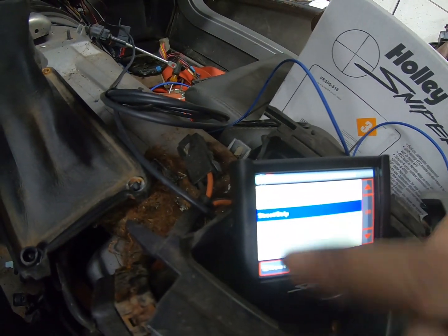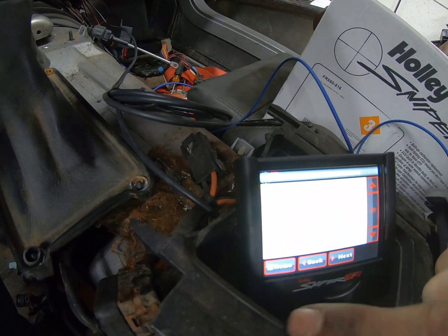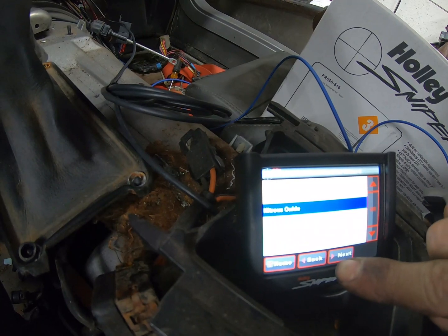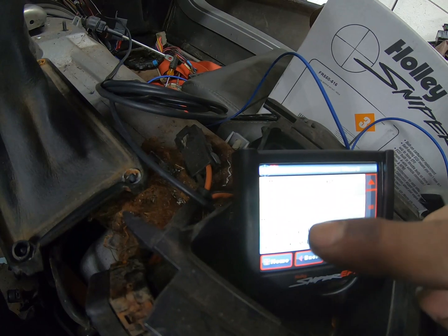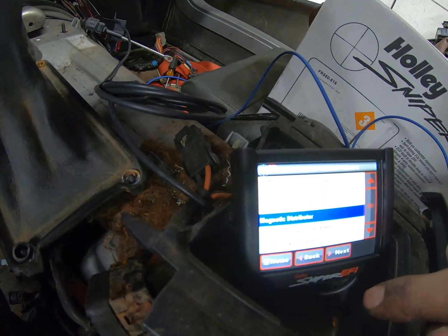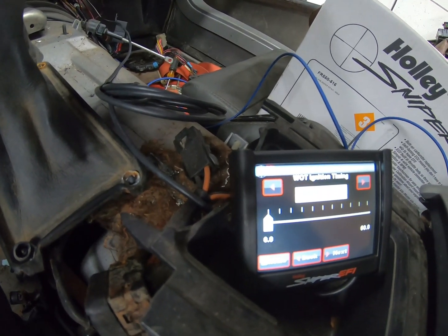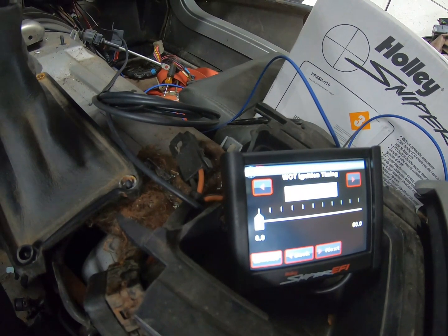This has a street strip camshaft in it. Have MSD distributor. No box. I'm gonna let this control it. Wide open throttle ignition timing. So if I'm 15 pounds, start at 30.